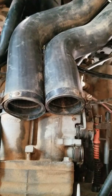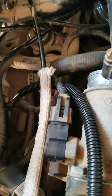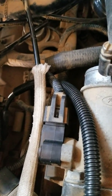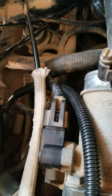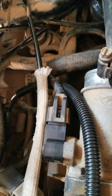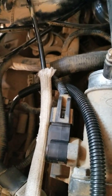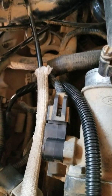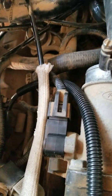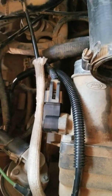I've got to check the wires — there are some good videos on how to do this. One guy said it's very touchy; you can accidentally cross the wires and short out your ECM, so that's kind of a scary thought. But I need to check the voltage on the wires and make sure we've got the proper voltages. You can even check the resistance too.